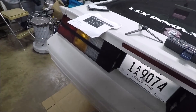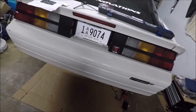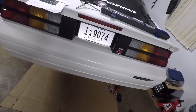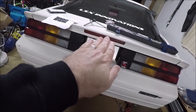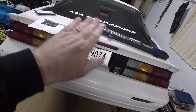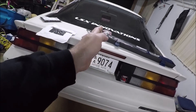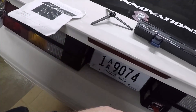You've heard people talk about steering the car from the back of the car — this is one of the ways you do that. When the car takes off, especially if you're pulling the front wheels a little bit, if your front end's coming off the ground and the car starts going to one side, this is going to let you dial it in to kind of keep it straight. So when you are pulling those 60-foot wheelies, the car keeps tracking straight instead of going to one side or the other when you obviously can't steer because your front wheels are in the air.